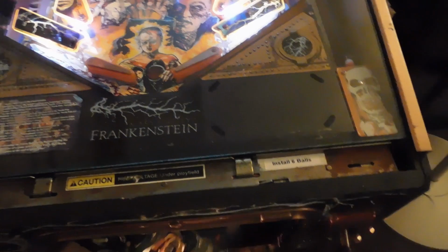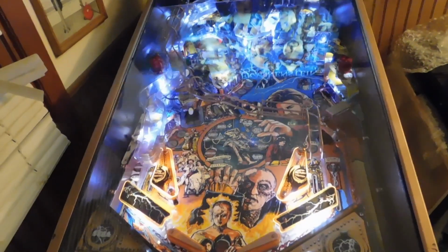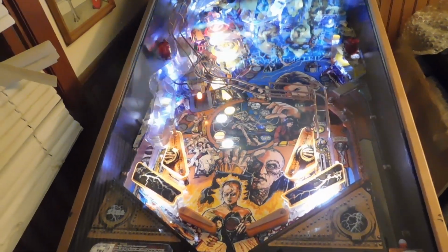The glass is basic, just like any other pinball. Slide it out very carefully, support it, so you don't crack or break it, alright? So, I won't show that part just because, one, I'm by myself, and two, it should be self-explanatory. Hold this bar, like I'm doing right now, and this lock bar is going to pull up just straight off the game. You just pull it straight up, and it'll come right off, okay? So let me do that real quick, and we'll continue on. Okay, so I got the lock bar off. Now I gotta just slide the glass out, and then take it out of the pinball machine. Okay? So I'll do that real quick. Be right back.